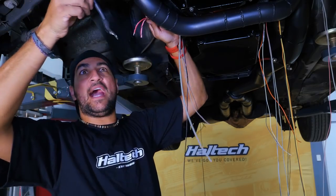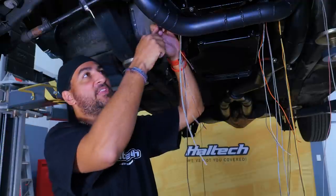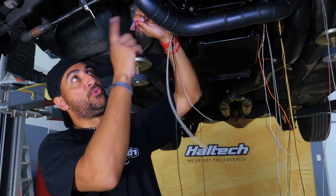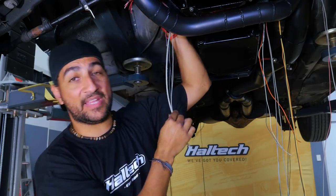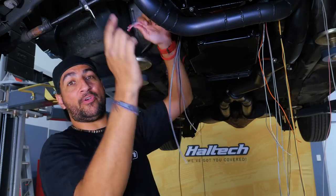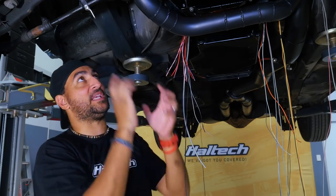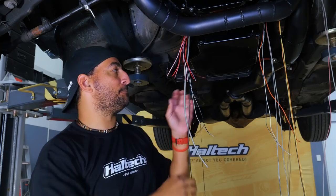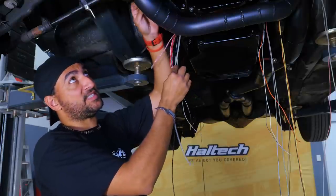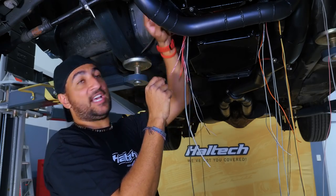There will probably be another little joiner which will go up to the alternator as well, so there'll be three lugs going onto that starter. It may be too much for that actual starter post, so we may need a relocation up here where we can put all of those positives - just so there's not 50 things hanging off the starter motor, getting cluttered and bulky, and maybe risking a short. We'll sort that out. I've got my starter wire here as well - that's our trigger to make the solenoid and the throwout for the starter motor work.